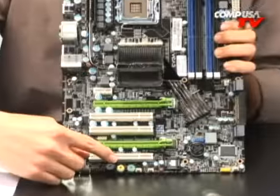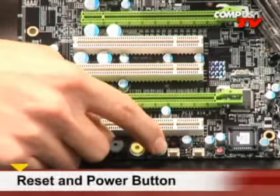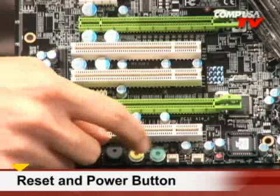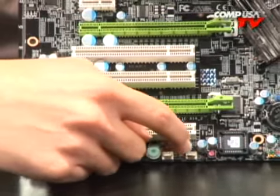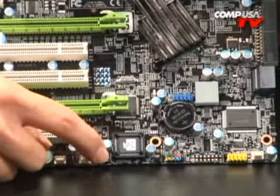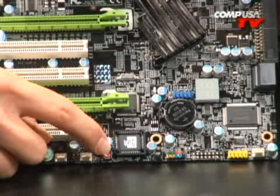Check this out. Look at these 2 buttons right here. You press them. That's your reset and your power button. So when you're benching the computer, building it outside of the case, you don't need to hook up those power buttons, all the little dip switches that are all annoying. You can do those. And let's say you overclock and you take it a little too far and you need to reset your BIOS. There's your clear CMOS button. No jumping pins and pulling batteries. You just push the button and you're good to go on that.